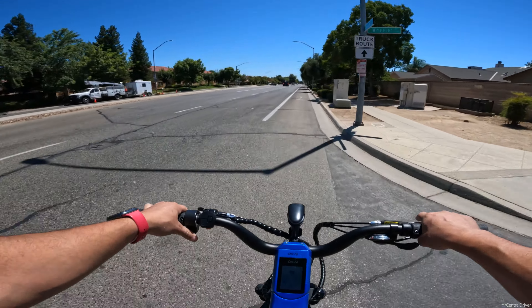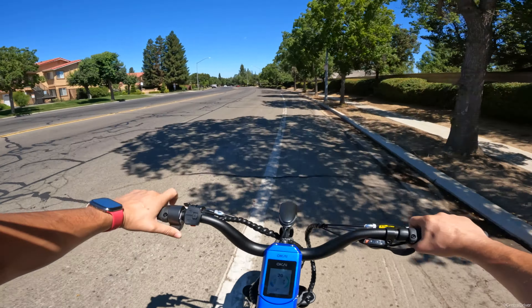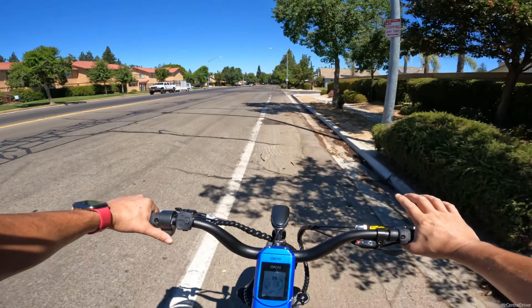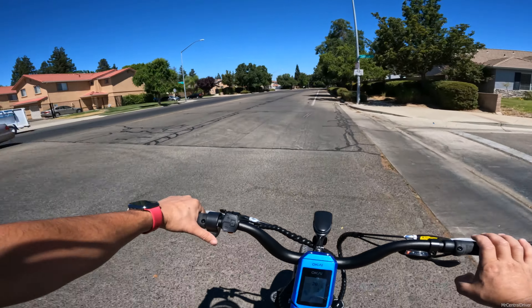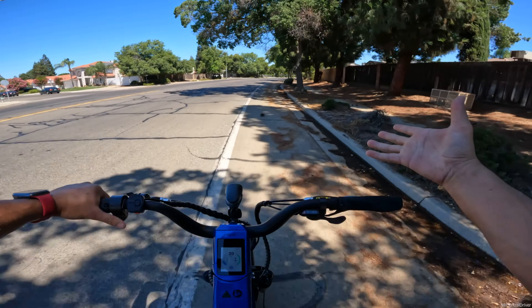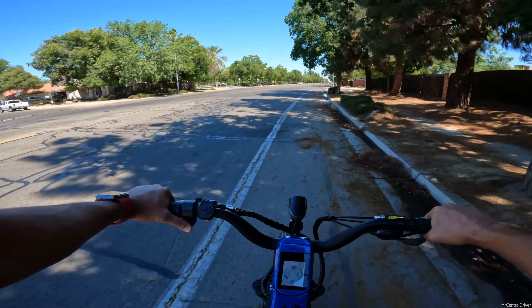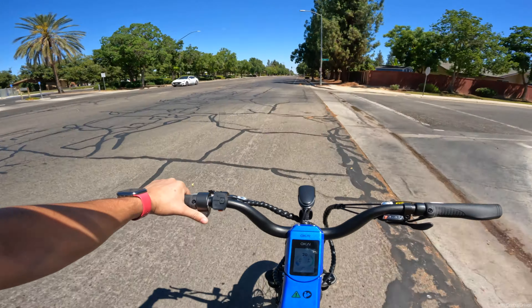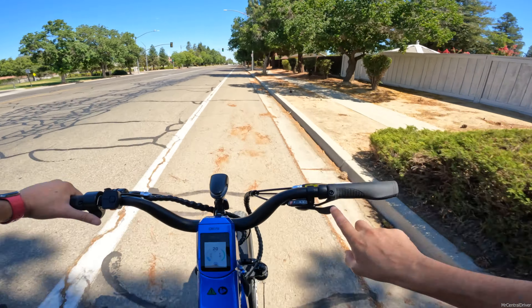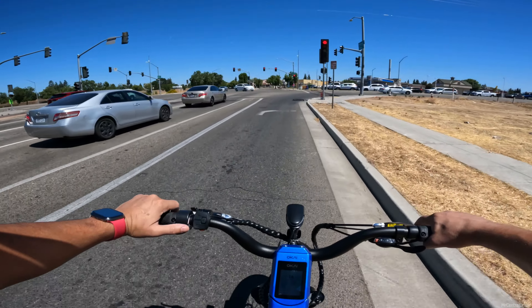You might notice I'm not wearing gloves today — it's a 20 mph bike, I didn't feel I needed them. I was also trying to get a feel for the grips. They're locking grips with just one screw — most locking ones have two — and they're not moving at all. The form-fitted palm feels perfectly fine. I do want to move the throttle slightly down so my thumb sits more underneath the bars. I also moved the shifter slightly over because this arm was rubbing against my thumb — that fixed the problem.